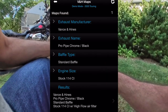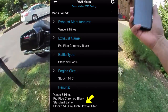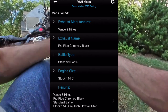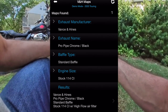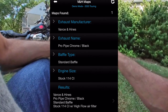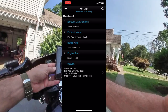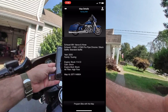Because the map they have, the map that they dynoed, will be for the high-flow air intake. And performance will be close enough, but not exactly the same. That's why they tell you to actually start with this. They literally tell you, if you only change your pipe, use the high-flow air intake. And with auto-tune, it will tweak and give you the optimal mapping for it. So now that we chose that, we need to apply the map.